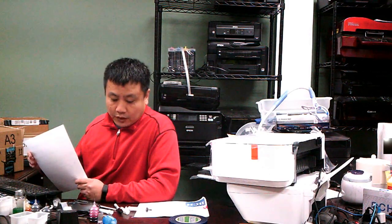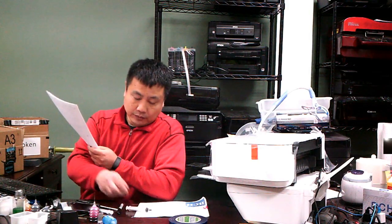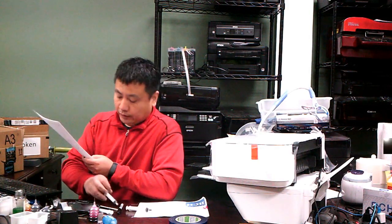First thing to do is put more ink, put it until you're full. We're talking about a refillable cartridge here, okay, and not the original Canon. For the original Canon, you want to put 2 mils, rather than 5 mils for color. So that's our plan A: make a refillable cartridge, fill it all the way, and unclog it using the primer.